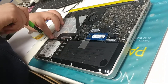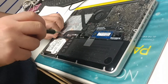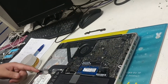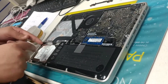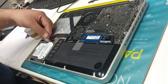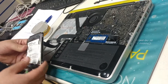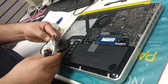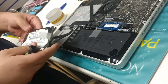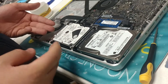Don't try to undo it all the way. Just do it like so — you can then lift the original hard drive out where it's connected by the SATA ribbon. Undo the ribbon and now you have the screws.